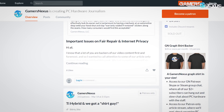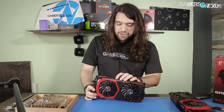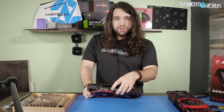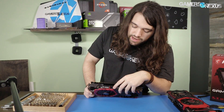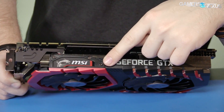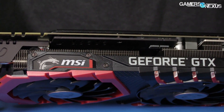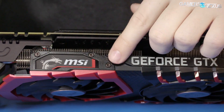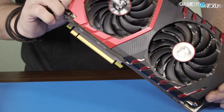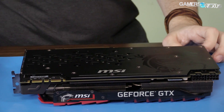On the backside we have Phillips screws all over, and star screws in the shroud — fortunately those are not relevant today. Removing those star screws would basically pull out the LED plate, so they're not mission critical but worth pointing out if you wanted to take the entire thing apart to paint it. Also of note, GeForce GTX branding is on all these cards now — possibly some Nvidia agreement.